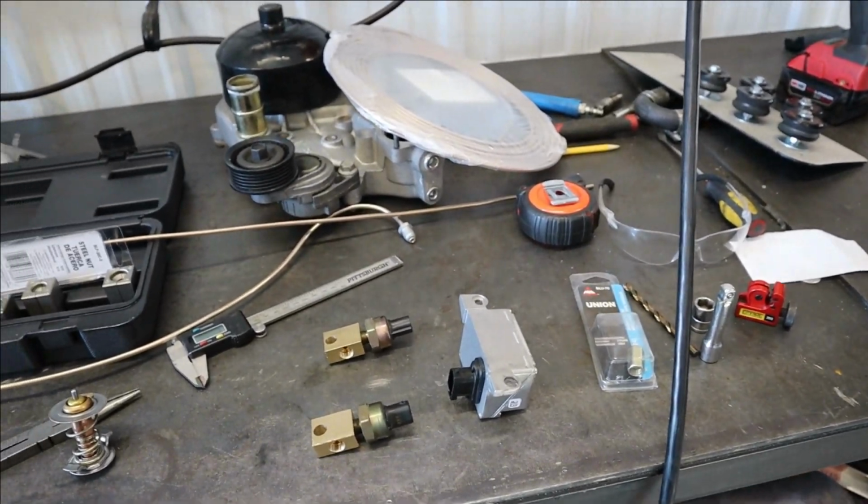All right, I don't know if I've done a real good job explaining what I'm doing here with the brakes. So the factory brake system in the Corvettes isn't, in my opinion, that good. It's way too front heavy for bias, which you can solve other ways, but ice mode would be the biggest issue with it. You can research any number of other people's opinions on ice mode, and most of them are the same. It's not cool, especially in a wheel-to-wheel scenario, where if you're in a bad situation, you lock up the brakes, or if you smash the brakes quickly and they lock up and it senses whatever it senses and puts you in ice mode, it's basically like having no brakes, and whoever's in front of you is not going to like you. So I'm trying to avoid that.